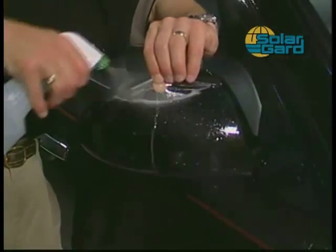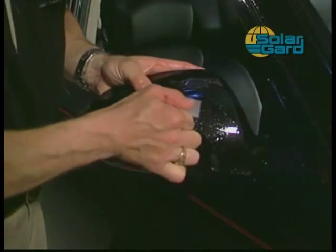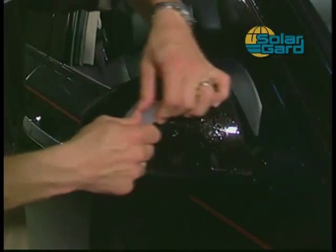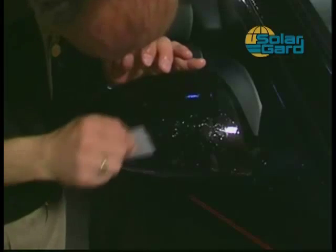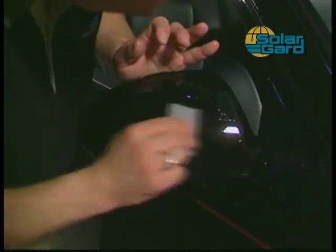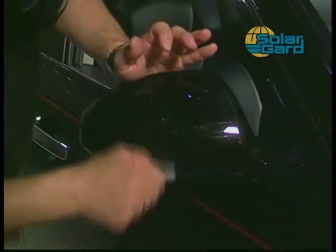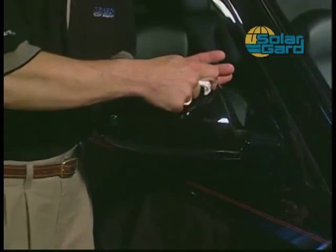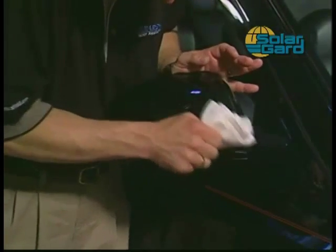Re-wet the mirror and squeegee the remainder of the mirror pattern from the center up and down as shown here. Remember to spray any finger areas generously with the alcohol solution to quicken the setup time of the adhesive before squeegeeing into place. Now, squeegee any remaining fingers with the squeegee wrapped in a lint-free paper towel. It may be necessary to shape the fingers using a heat gun on a low setting, as previously demonstrated.